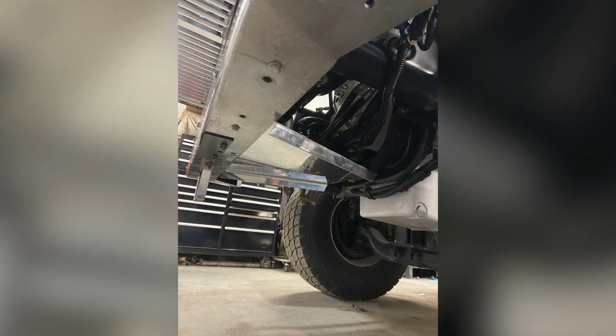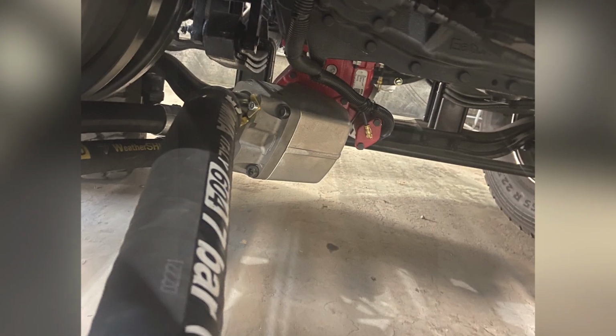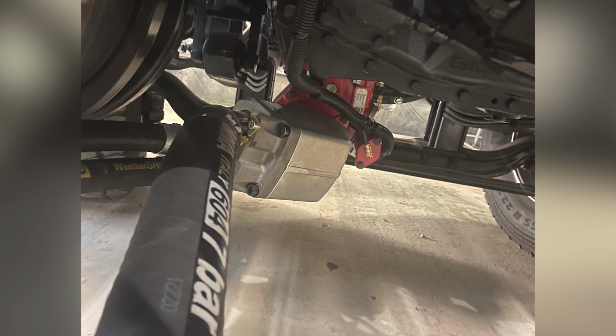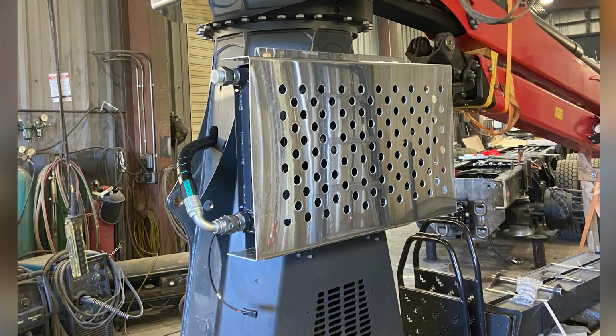Normally these trucks kick up a lot of dust, and I wanted to avoid that. A custom air deflector was fabricated. Next up was adding the hydraulics and loader. A Parker 7070 piston pump and hard lines were added, then pressure tested. Palfinger M13A loader was mounted with a Serco trash grapple.